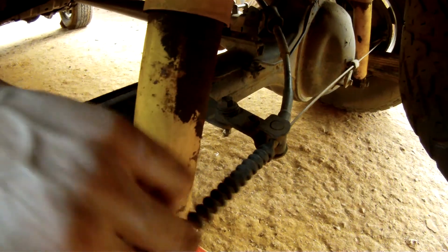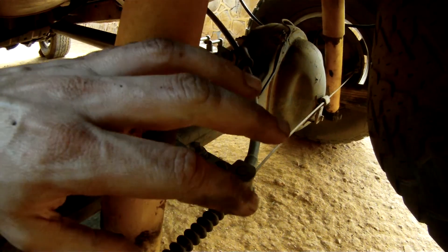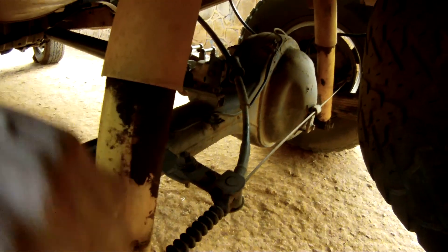The handbrake is really quite useful, particularly when doing hill starts off road, for having a handbrake that actually stops the vehicle when you pull it on. So in general the braking system is probably okay and looks quite well, but they've compromised on the rear. I think Land Rover's got the better all-round braking system for maintenance — there's no reason why drums can't perform as well, but discs are so much better, particularly in an off-road environment where you can clear them out a lot easier. If you get dirt stuck in the bottom, discs tend to be self-cleaning. So I think Land Rover's got it right with discs all round.